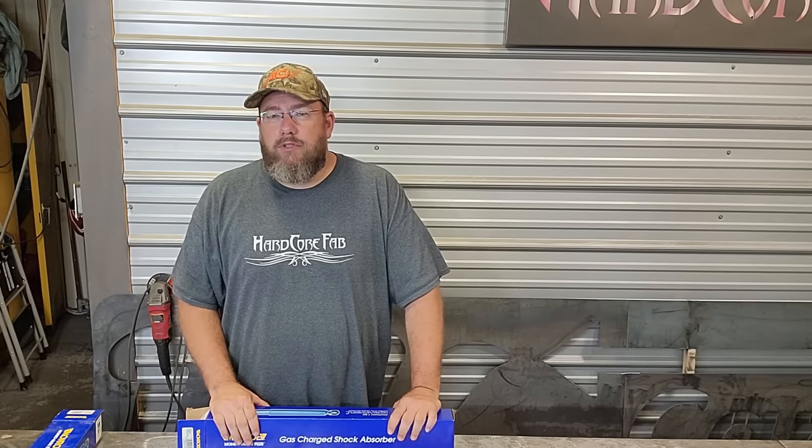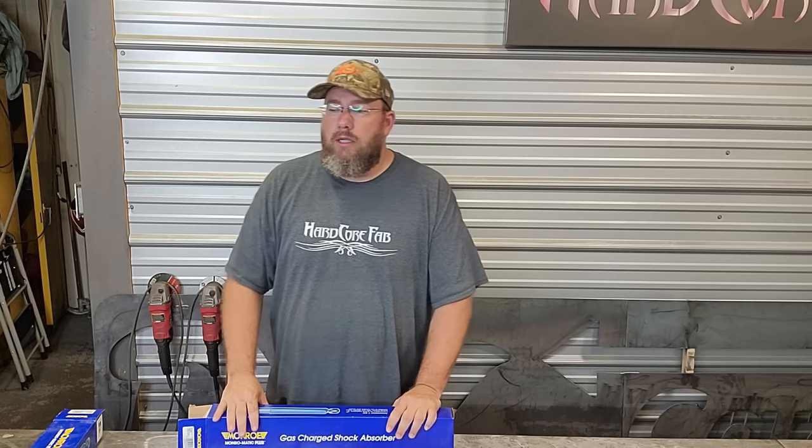I am, however, going to put a strut off the back side of it going back to the cowl or firewall area where the original strut was for the core support in the truck. I'm mostly doing that because we have the shock mounted right high up on that bar, and that'll help take out any movement. There's not going to be much, because most of that shock is pushing straight up on the bar, but there is a tiny bit of leverage, just a couple inches off the side of the bar. So I am going to do that to help support it a little bit. We'll do that on the next video.